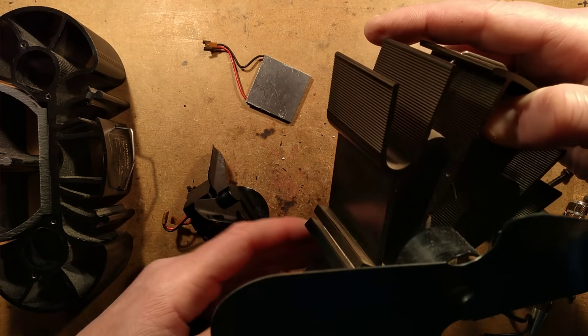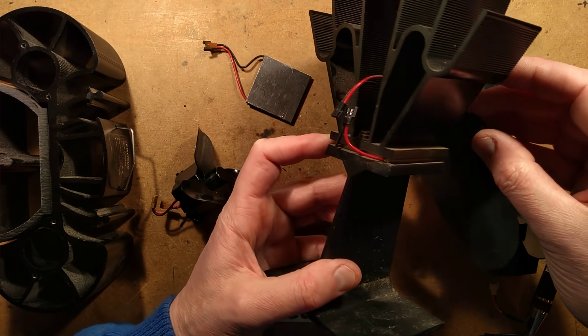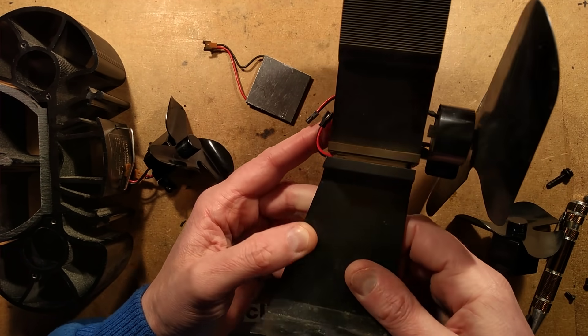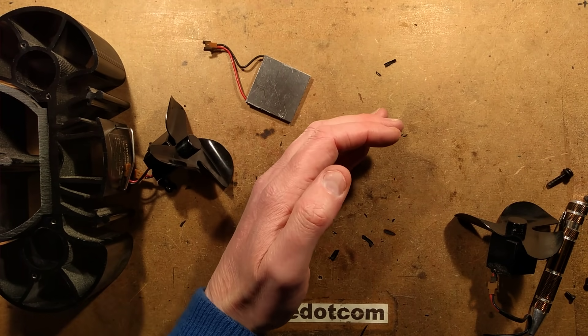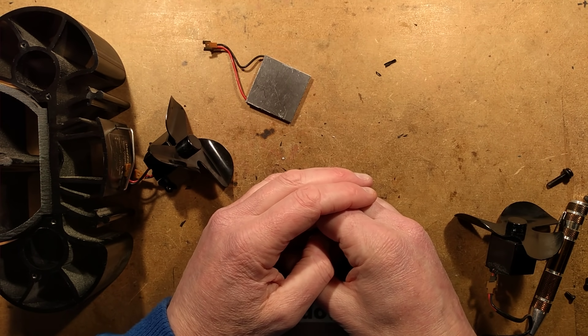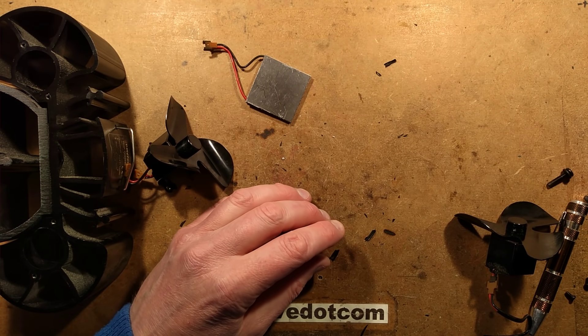This one's faulty as well — it's my brother Ralphie's. I think I'll see if I can get another Peltier plate for this as well, because it also conked out and it was taking longer and longer to start up. I reckon it is the Peltier junction plate that's giving the problem. I shall investigate that and possibly update this video in the future when I've got those components and have installed them.